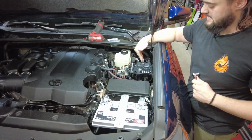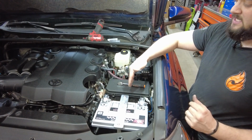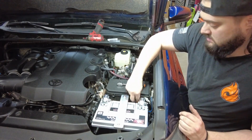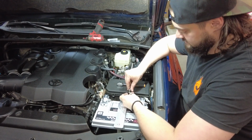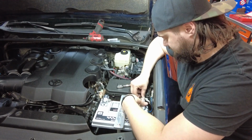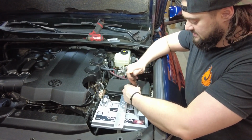Obviously you saw I connected the power and ground to the power switch itself first. That's so that if we connect it over here, we don't have live wires floating around back here while we connect them to our component. So we'll go ahead and take one of the little bolts for the back of the SDHQ terminals now, and we'll tighten that one down so we don't have anything else connecting to that bolt.